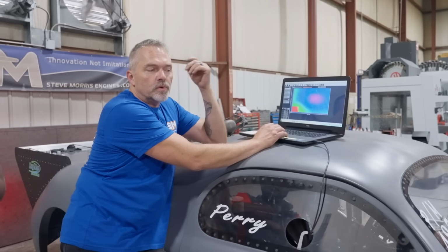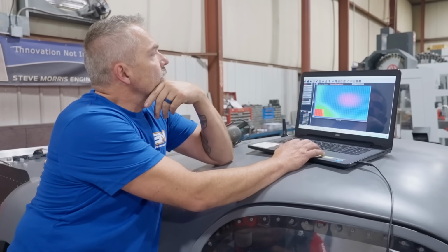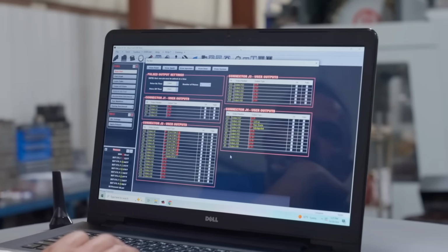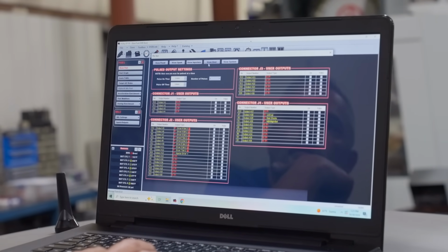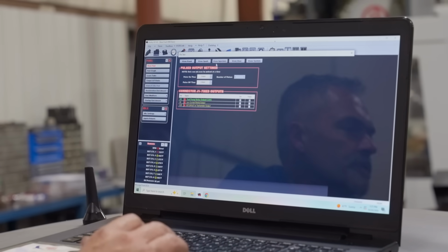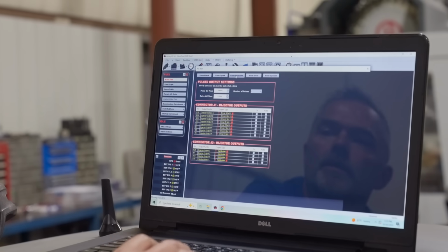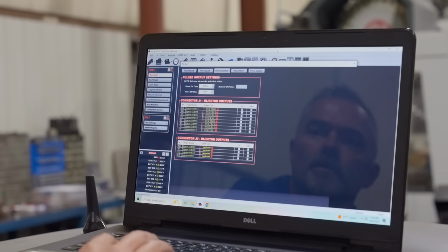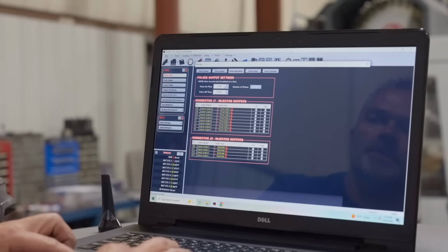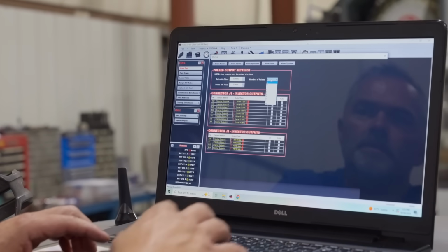All right. So here's how you test the output. We can test fire injectors. You can test fire coils also. You go to your output test. You need to go to view fixed. You need to turn on the fuel pump relay. It's a complicated series of pulleys and levers that you've got to pull to do this. But all right, so we go there. Now we're going to go to injector. That's number 8. Should be this one. So you've got to set this up. I just set it at 10. Set this at 10. Set this at 10.